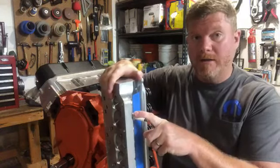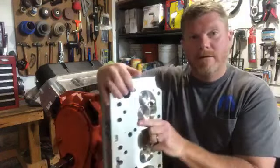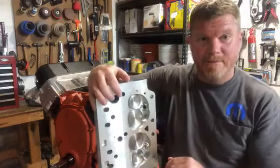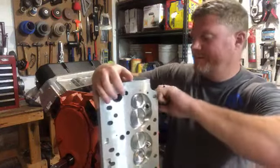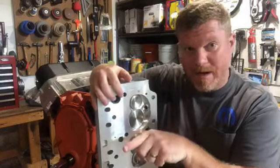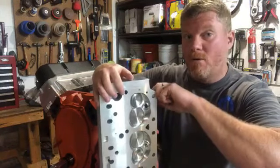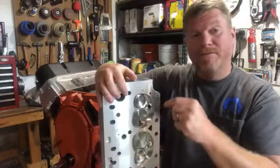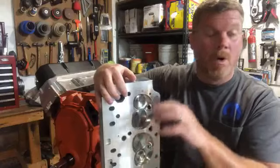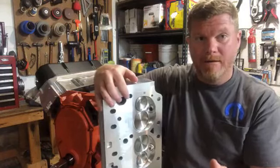If you do not, you will have trouble, all right? Well, here's where it gets interesting. If you do not torque it tight enough, that means that the tip of the spark plug is not deep enough into the combustion chamber. It means that the flame is too far away, all right? And if the flame's too far away, it might not get an efficient or proper or complete burn. And now you're running foul, you're running bad, all right?